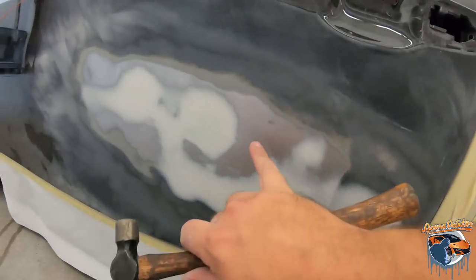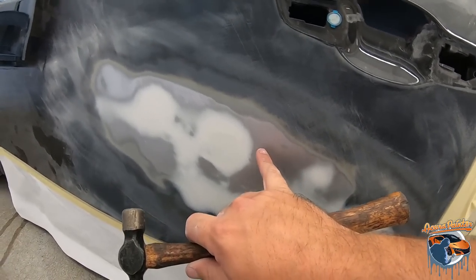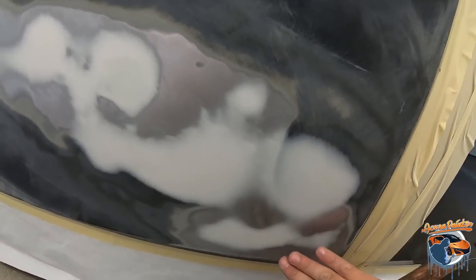And a high spot can happen when you're pulling. You know, you're not gonna pull it 100%, so this is kind of where you gotta work the metal a little bit. Just because metal's showing does not mean it's a high spot. That's why you have to feel using your hand to determine where those high spots are.